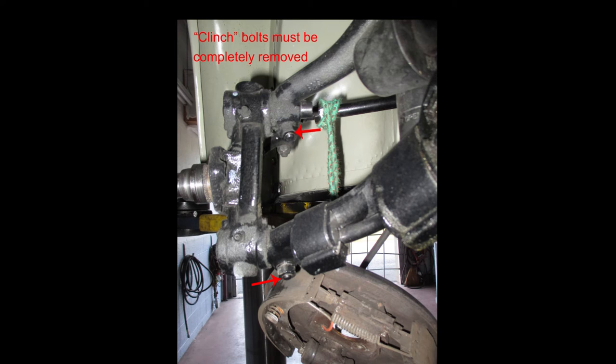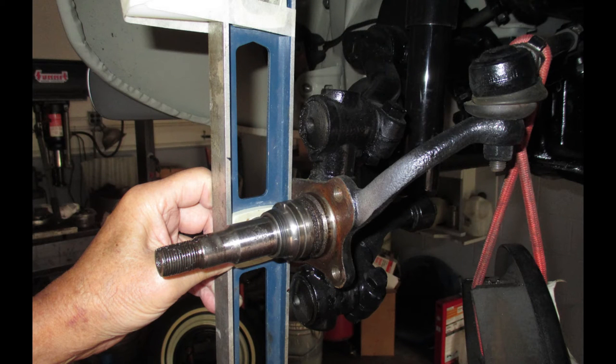Never hang your brake plate from the brake hose - that's a no-no. There are three bolts that hold the brake backing plate to the spindle, so never let the backing plate hang from the brake hose. You do not have to remove the brake hose. Here I have my level against the spindle checking for vertical, but what I'm going to do is take my sheet metal channel and drill two holes in it for the two holes in the spindle, and it'll be vertical and the width of the wheel, so I can put my level against that to be more accurate.